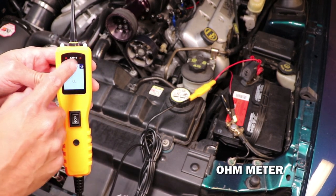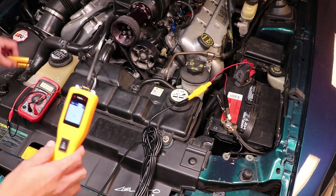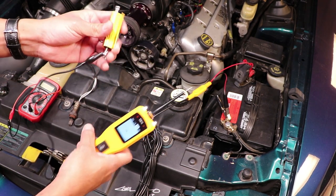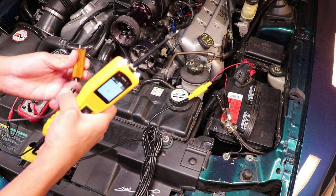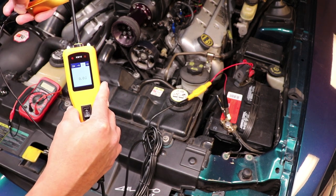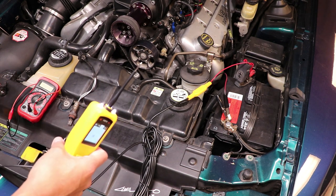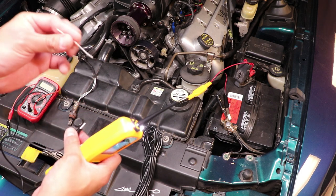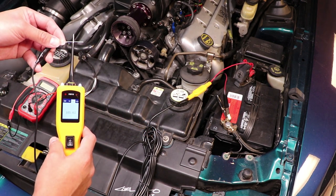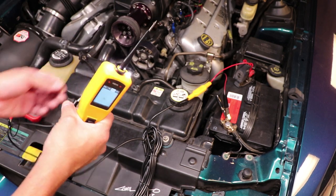The next option is resistance, which is one of my favorite features. However, in my opinion this is not a replacement for a multimeter. For example, I have a 2-ohm resistor — if I connect the ground wire and probe it, I get a reading of zero ohms. So it cannot resolve down to 2 ohms even though it's advertised as 0 to 100k ohms. With a 100-ohm resistor, however, I get 100.4 ohms — pretty close. So it works well for larger resistances.